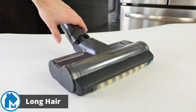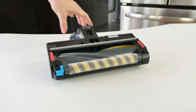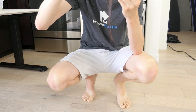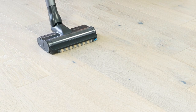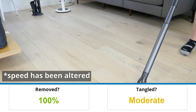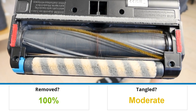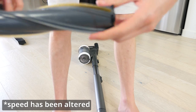Our long hair tests check how well a vacuum is able to clean long hair without it tangling around the brush roll. To test this, we placed long strands of synthetic hair in the direct cleaning path of the Samsung Bespoke, ran the vacuum over it, and checked the floor and brush roll. All of the hair was removed from the floor — no problems there. However, a moderate amount of the hair did tangle around the brush roll. Luckily, removing the hair was easy to do by hand and it didn't cause any major issues.